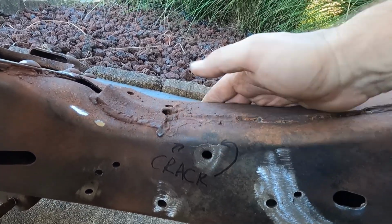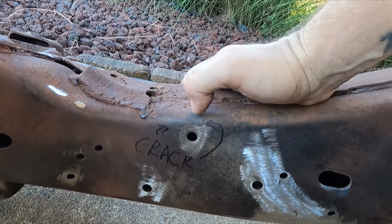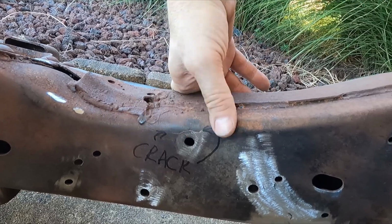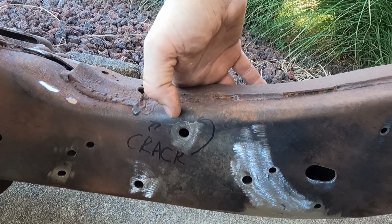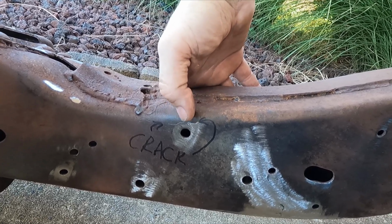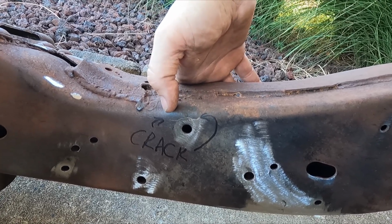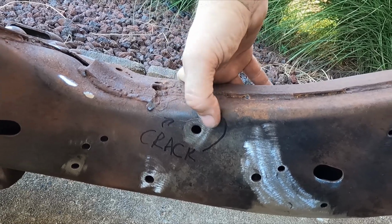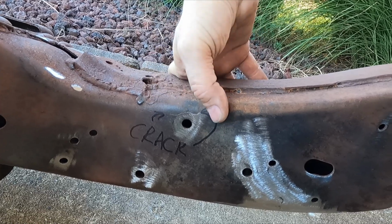So I'm gonna go tomorrow. That is gonna be my thing for tomorrow. I'm gonna clean this area up really, really nice with a knotted cup brush, a stainless steel one, to get it clean. And then I'm gonna put my magnifying goggles on that my really good friend Jeremy bought me. I'm gonna put the highest lens in there, which is I think a 3.25 or 3.50, and I'm gonna look at this real good, and I'm gonna drill a hole at the end of each one of them cracks,